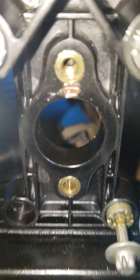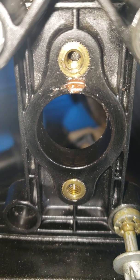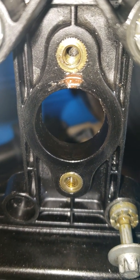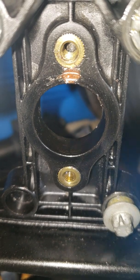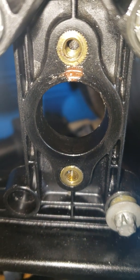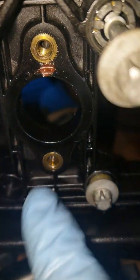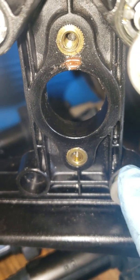I'm going to show you a little trick I learned to get your valvetronic unit to manually move to max lift. I recently had an issue where my car would not start. I read the ECU and the DME and found some codes for the valvetronic unit. I wasn't getting any clicking or noises — it seemed like one day the electronic motor that comes through the top of the valve cover burned out, so it wasn't able to turn the eccentric shaft anymore. The car was sitting at minimum lift, so there just wasn't enough airflow to keep the car running.